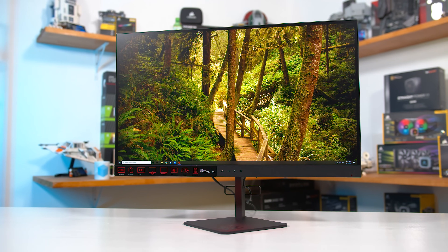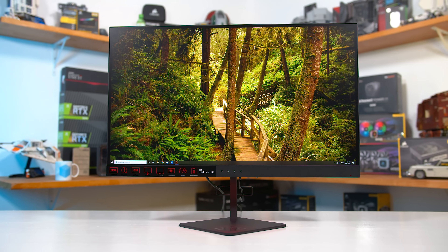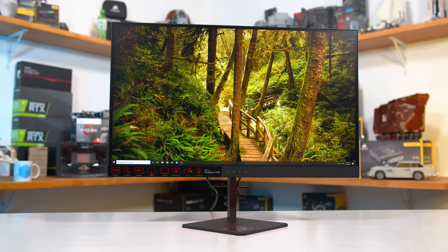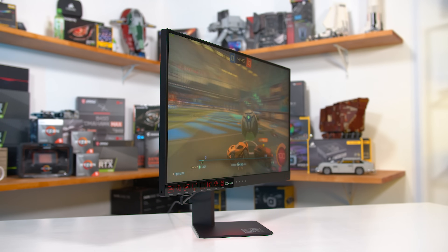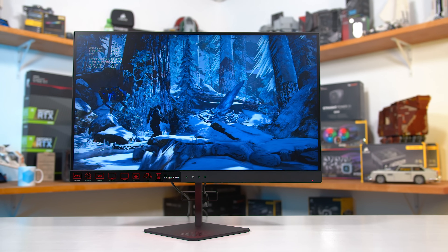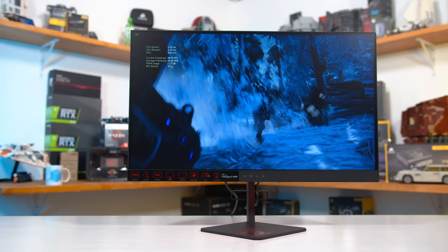Color performance is also very strong from the factory — surprisingly so for a gaming monitor that doesn't boast about factory calibration. Minor oversaturation issues can be corrected with a software profile, but even without one this monitor has great colours. Most downsides are standard TN: poor viewing angles and a weak contrast ratio — the key trade-off for elite performance. If you game in a dark room, the higher-than-average black levels may annoy you. There are also some design annoyances like the hard-to-use on-screen menu and lack of VESA mounting support, but these aren't that significant if you want the absolute fastest 1440p monitor on the market.